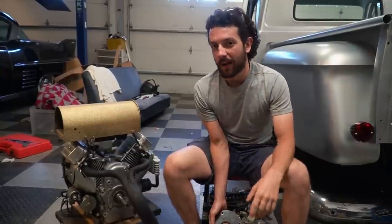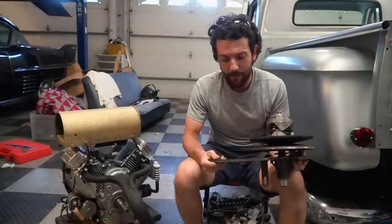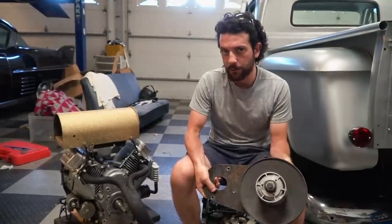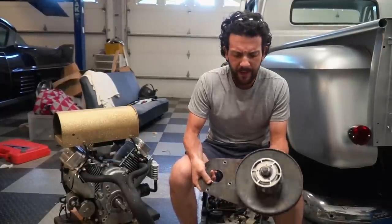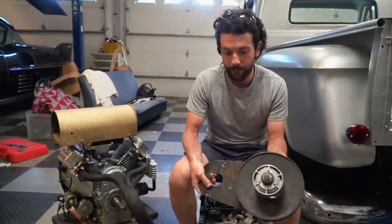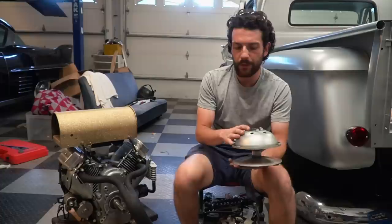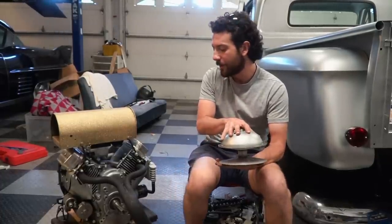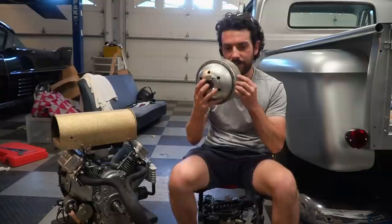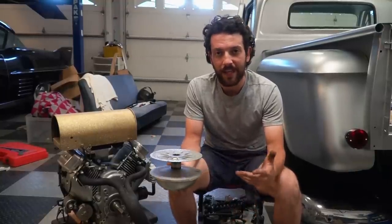To put the power to the wheels on this drag rail, we are using the mighty 780 torque converter from GoPowerSports.com. This thing is pure beef — look at the thickness of that backing plate. It's rated between 18 to 30 horsepower applications; however, we've been running it on the drag rail with like 55 horsepower for dozens and dozens of passes and it's held up fine. This exact setup has also been on our Honda Davidson street legal motorcycle with hundreds of miles on it. The driver has different stall weight options — this is the standard stall, around 2,600 RPM engagement. Check it out via the link in the description from GoPowerSports.com.